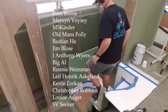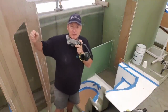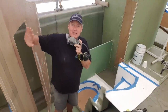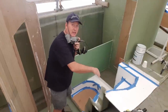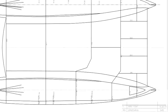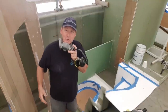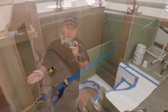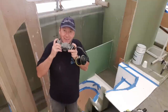So I've got the forward starboard bulkhead in — that's now filleted and peel plied. What I'm going to be able to do once I come back is tab all the floor and that bulkhead in. Now I'm going to put in the midsection bulkhead, which is actually part of the main bulkhead. It comes across this companionway and then doglegs back to the main bulkhead — two sections. Pretty important one, this. Once it's all glassed in I can get rid of my support strap holding the sides in. Once I've got the two bulkheads in, I don't need that anymore — which is great news. So I'm going to sand this area, get it ready for filleting, and get this one in today.